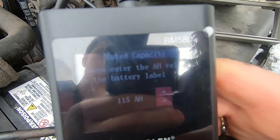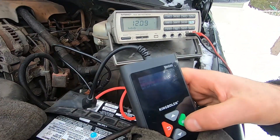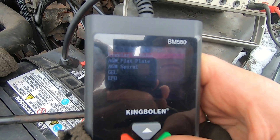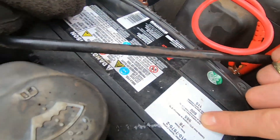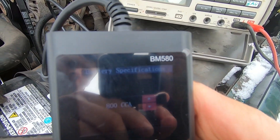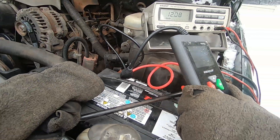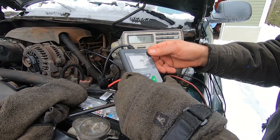It's asking for the amp hour rating, which I don't know, so instead we'll do an in-vehicle battery test. Confirm the engine is off. Battery type is regular flooded, and the cold cranking amps are shown as 800. Running the test — it says it failed: only 16% battery health. I'll agree that running this test on a discharged battery isn't ideal, but we're going to do a few other tests.